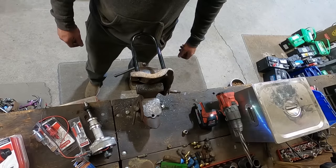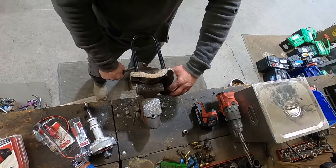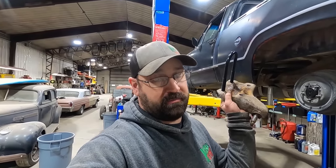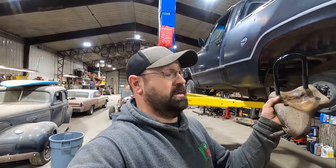All right. Test that out. As I stated earlier, this is a generic flip kit. If somebody catered to the Mopar folks, they would probably have one that would have something like this that fit with your bolts without any reaming. And they would also have one of these that's made for flat being on the bottom of your leaf springs and not rounded like this original saddle and has a spot for your shock. And better yet, it would come with lowering shocks.